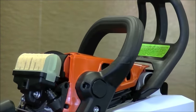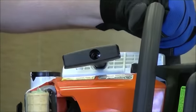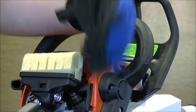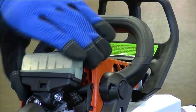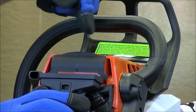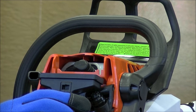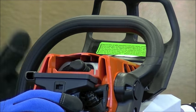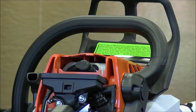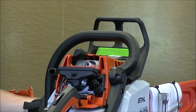That'll give you another angle in there. Your air filter and your spark plug are going to be on top here — you can see the top view of it. First thing we're going to do is pop off the air filter; it's two tabs that clip in there nicely, one on each side. Then this shroud here we just pop up and that gives us full access to the spark plug. You can set the air filter stuff aside for now. There's not really a difference from your lawn mowers and string trimmers — just pull that spark plug wire off.